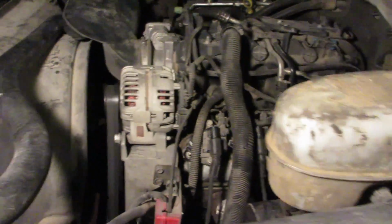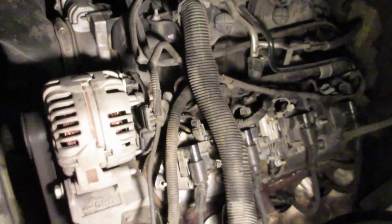A little bit of a whine. Is that our power steering pump? Are we probably low on something? Let me check that real quick, now that I can hear stuff. Or you know what? That could be the transmission making noise. Uh-oh, that ain't no good. Let me turn the wheel and see. Hopefully that ain't the transmission pump whining. It's like I couldn't even hear that before, so who knows? Hopefully it's just the power steering pump whining a little bit. Maybe we'll get lucky.